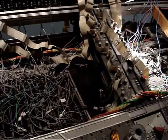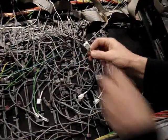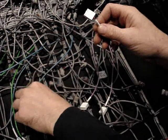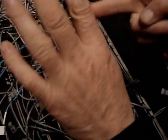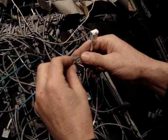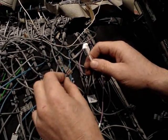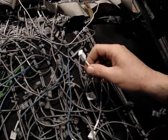Show us these new connectors. Yeah, it's pretty interesting. These connectors are crimped and then they're soldered. As opposed to before, they were just pushed in between like a fork. So this should make a much better contact. Eventually the contact becomes much less — after years of wear and tear and heat in the console, it oxidizes a bit. Especially with small signals, it could interrupt the signal.